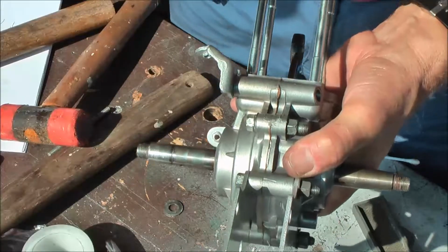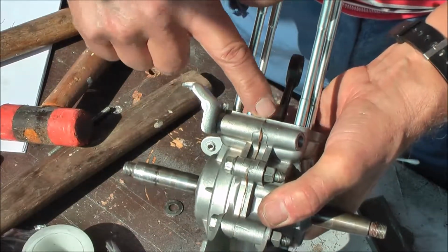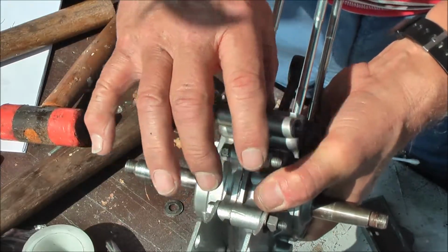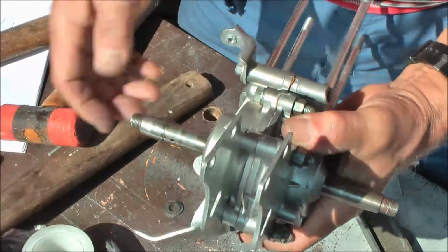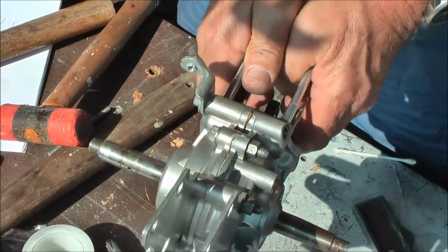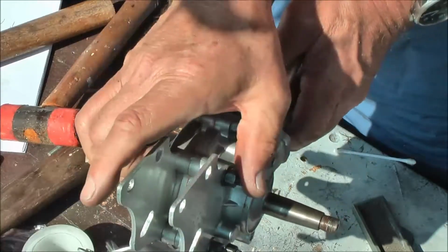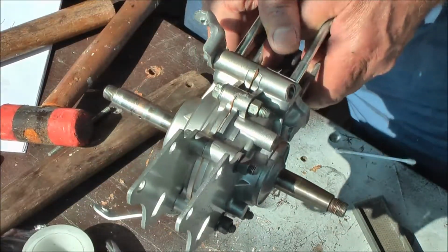I forgot to say in the video that this should be joined in a way that it's completely flat. If not, untwist all bolts and tap or twist it in this way with the bolts still in place so that the joint doesn't slip in a wrong way.